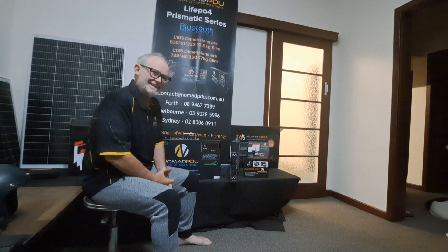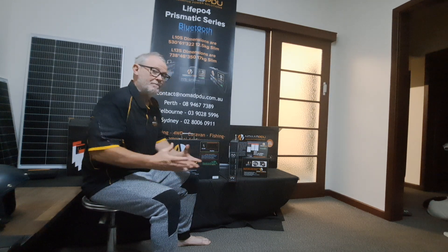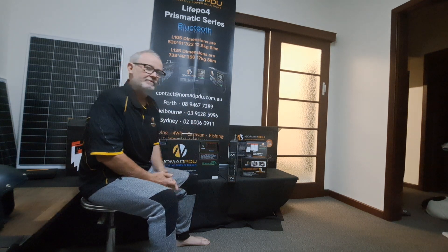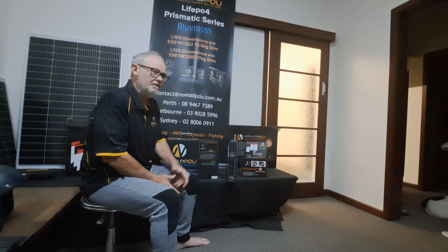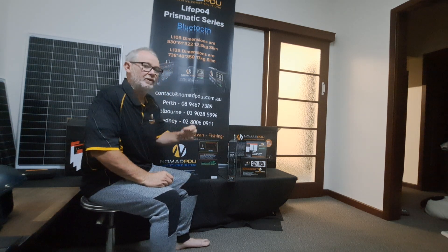Today I'd like to talk further about the V6 and how it came about. It's a V6 HD 1A5 and 200 amp hour. They are prismatic, but I also wanted to talk about charging profiles and lithium particularly. Now the transition between the V5 and the V6 is quite a big jump in chemistry. The V5 was NMC — nickel, manganese, cobalt — and the charging profile on that was 12.6 volt.